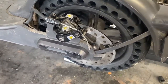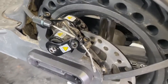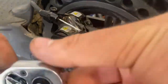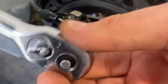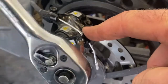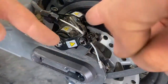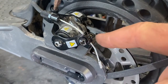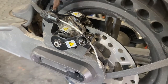Today I'm going to be changing the brake pads — or at least looking at the brake pads — and I'll show you how to gain access to them. It's nice and easy this one. We always start off by releasing this one here just to release the tension on the brake. You'll see the arm will slide down, which means it's loose and there's no tension on the piston. There are two little hex heads here that we release, and that releases the piston completely.